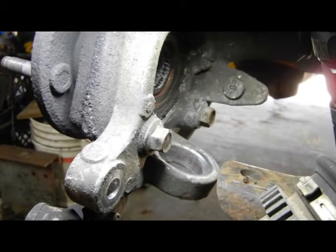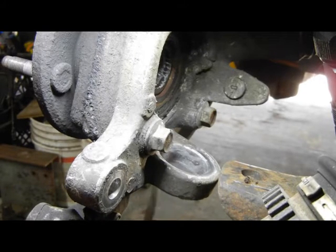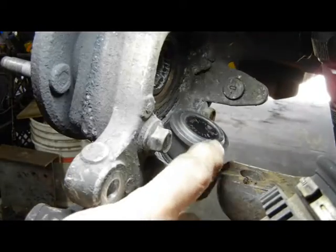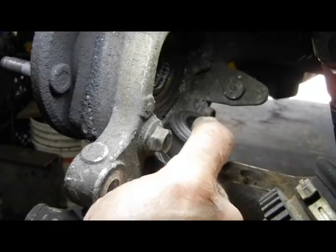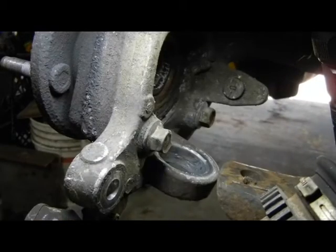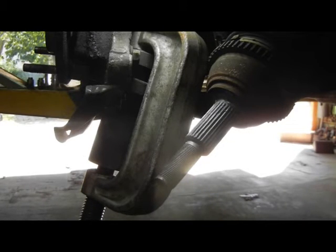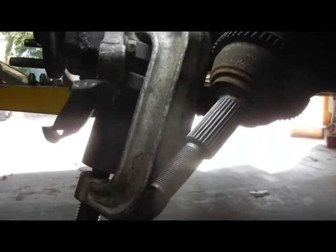We're going to use the proper tool to put this in and it'll all go back nice and even. This is the ball joint tool — I'll get that in nice and even, no problem. But make sure you press on the outer edge only. Do not touch the inner edge in here, do not press anywhere near this, because this will ruin the ball joint and you'll have to go buy a new one. Now with the proper adapters and the ball joint press installed, make sure the ball joint is going in straight. Make sure the screw on the press is oiled up or use some cutting oil on the threads, because that keeps them alive a lot longer.